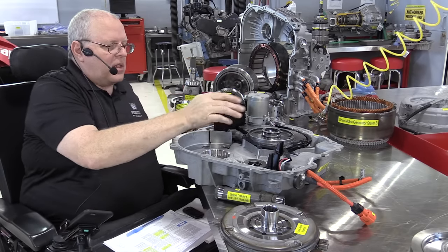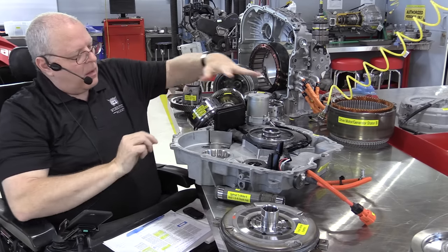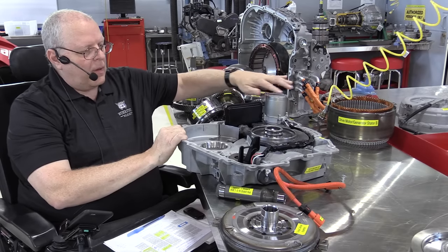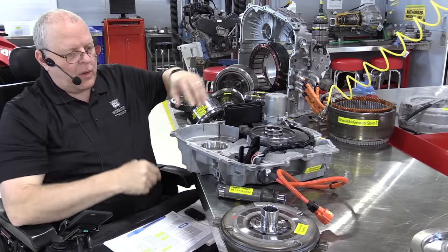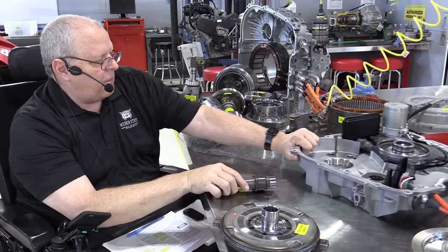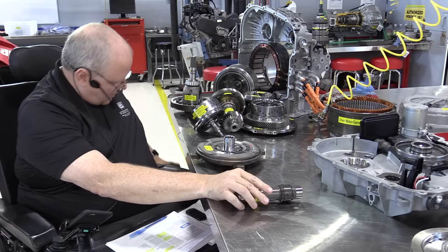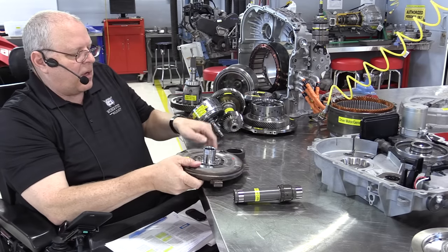And then you can see the oil pump housing here, our auxiliary pump, the fluid filter, and the electrical connection to the auxiliary pump. So now let me put this off to the side. Let's bring the torque damper over here, and let's see if we can make sense of the power flow that we talked about earlier.